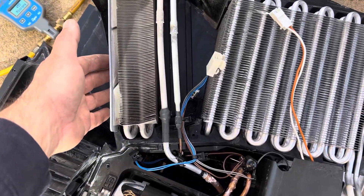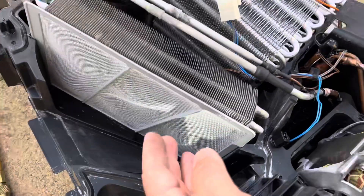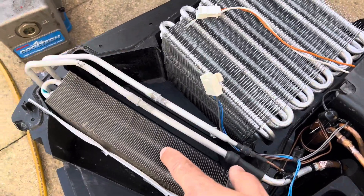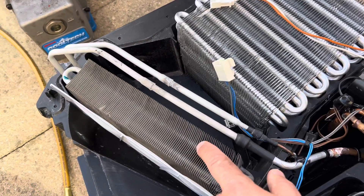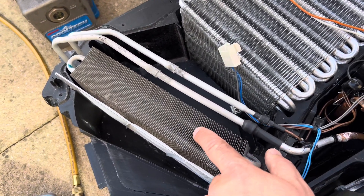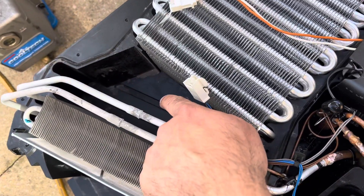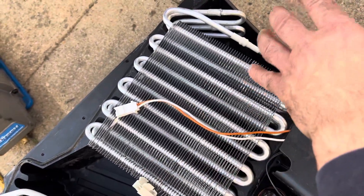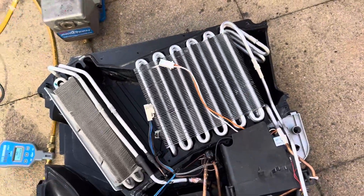The humid air is forced through this filter to this heat exchanger, which is very cold. The air loses the moisture because the water condenses in this tray, and then it continues its journey — it's reheated, very warm and dry, and it comes back to pick up the humidity from the clothing again.